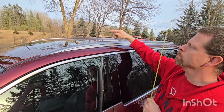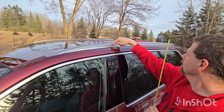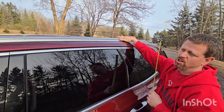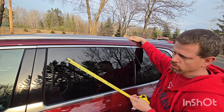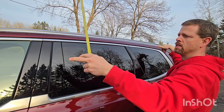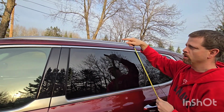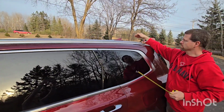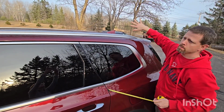I put a little piece of tape on each side at the 21-inch mark. And then I'll put the bracket here. And then I will put the other one back here. Kind of just guessing. Doesn't really matter where it goes. But when I go to do the next video to install the roof box, it has a certain location that it wants them. So I will adjust the back one to meet what it wants. And then once I set the box up there, I will ensure that the box doesn't hit the antenna or the spoiler when you lift up the back.